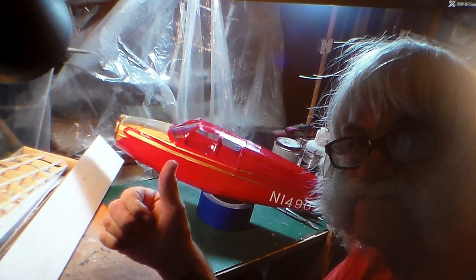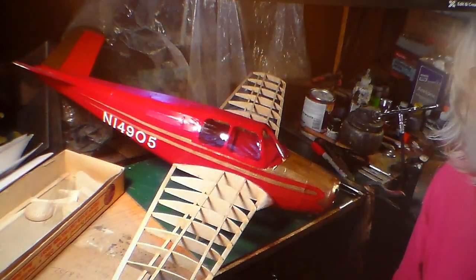But on the leading edge of the wings, I had to put a filler block in there to make sure it fits flush across there, and glued on that stringer, and also that spar will go through and glued to the bulkhead. That wing is secure, guys. Ain't going nowhere. There it is right now. This is the stage it's at now.